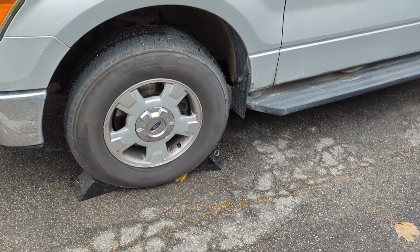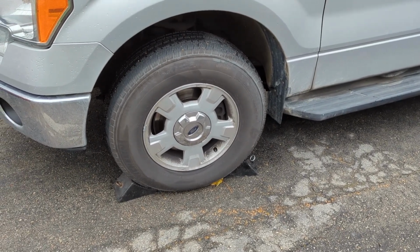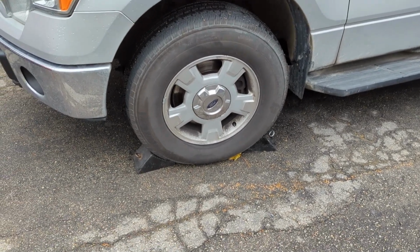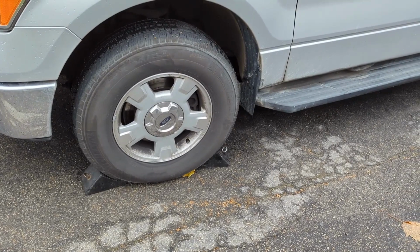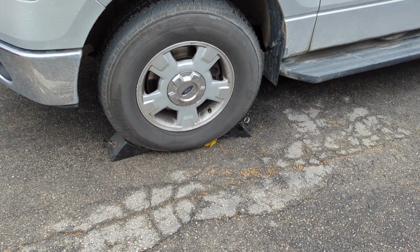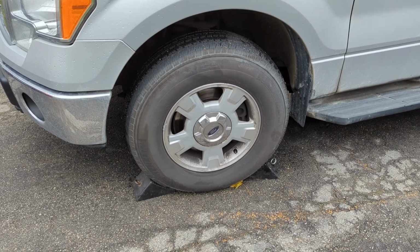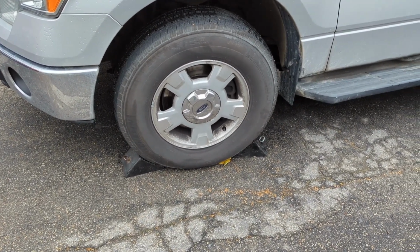Anyway, people want to set their park brakes, but they don't use them for the whole year or a couple of years, and all of a sudden they put them on and they're half seized, and then they don't come off, and it's always a big problem. So I never ever use park brakes on anybody's vehicle. I'm going to use wheel chocks in front and behind. That's fine when you're sitting on a nice level shoulder of the road, to keep your vehicle from moving back and forth.